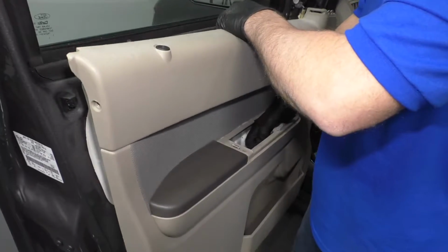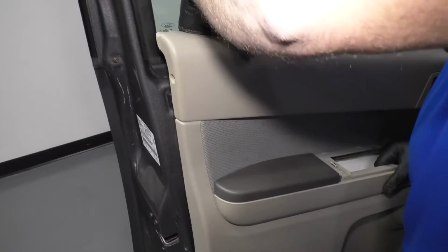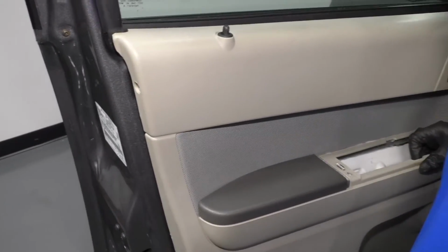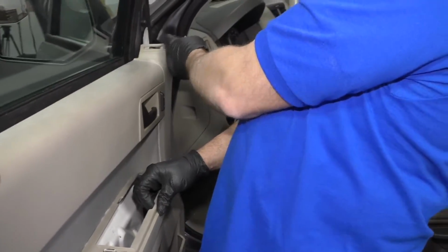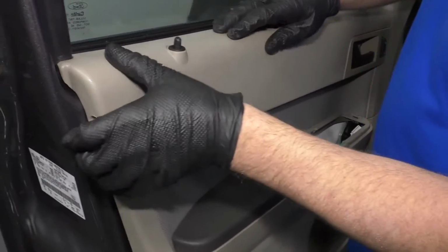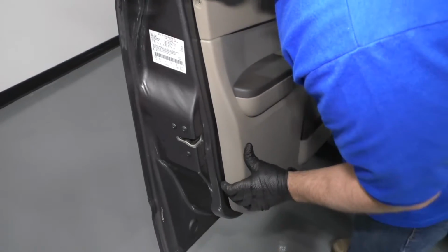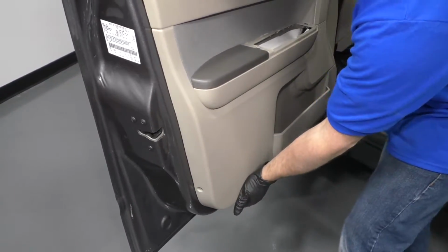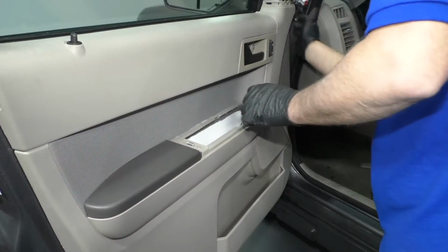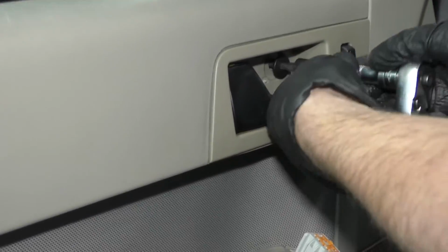We'll take the door panel, make sure those wires are right there. Take this lock rod, you want this lock rod on here. Line that up. And then with the top, make sure you pull that wiring harness out. The top of the door panel, we want to slide into place up here. That looks good. Then we'll get the door pins to line up all the way around. Just apply a little pressure. Just like that.